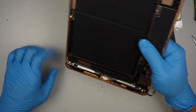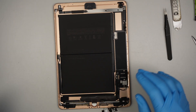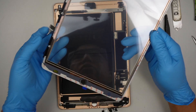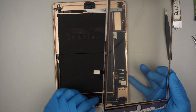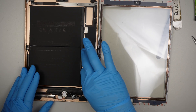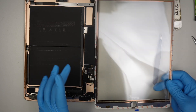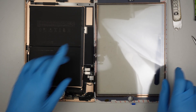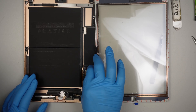As you can see, the battery is still connected to the iPad — it has not been disconnected at this point. I'm going to transfer in the new screen. Here comes the screen replacement with its two cables. Take your time installing these because they are just like Lego — they need to snap on right on top of each other. Do not force them in, because once you bend the connector pins it is going to be very difficult, almost impossible, to repair.